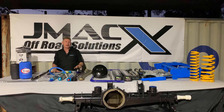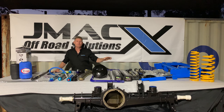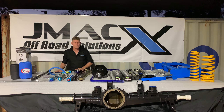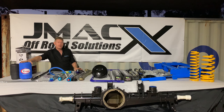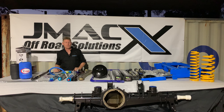Probably one of the biggest things that you get where you won't get anywhere else is a 2,700 kilo rear axle load capacity. As we load these cars, once you put people in the car, all your luggage goes in the back or it goes on your tow bar. Axle load capacity has become critical to get the use out of your GVM. There's no point saying I've got a 3.9 ton GVM but I can't practically load the vehicle and maintain rear axle load capacity.